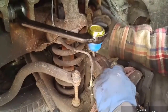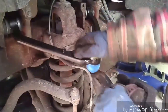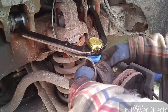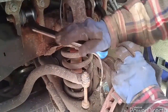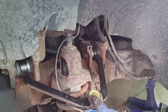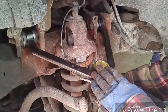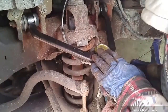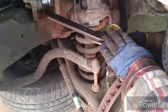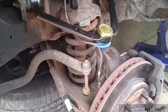We're going to lift this up. Pull your ball joint — it's a little stiff — pull your ball joint and stick it in, and put the nut on the bottom here. Give it a little tap. Finger tighten the ball joint nut so you can't do any more. Now hold the control arm in place.